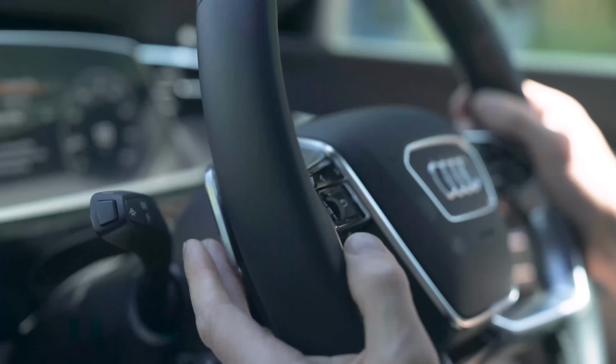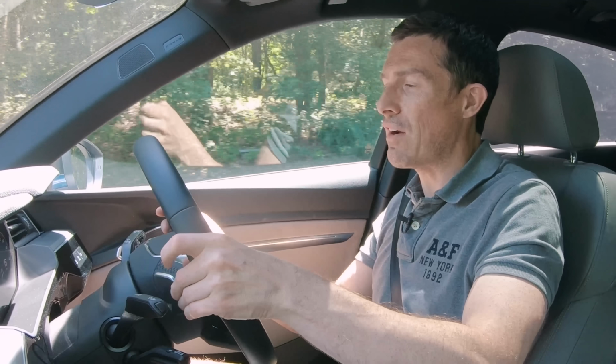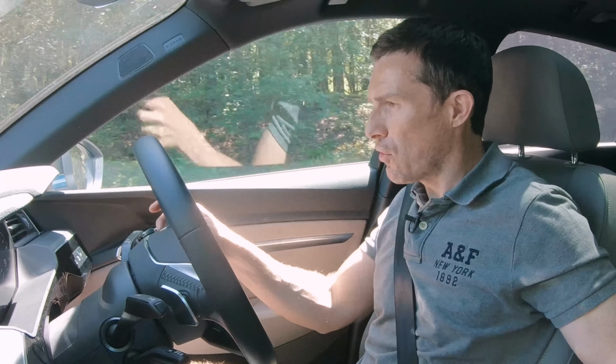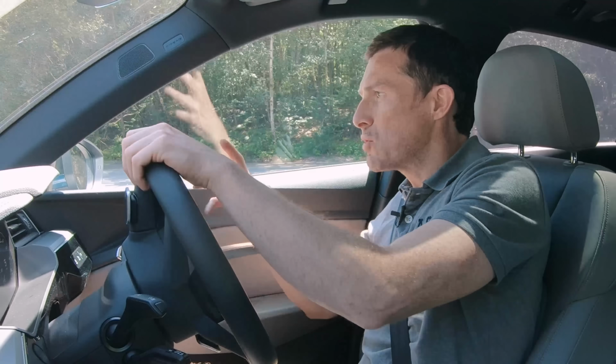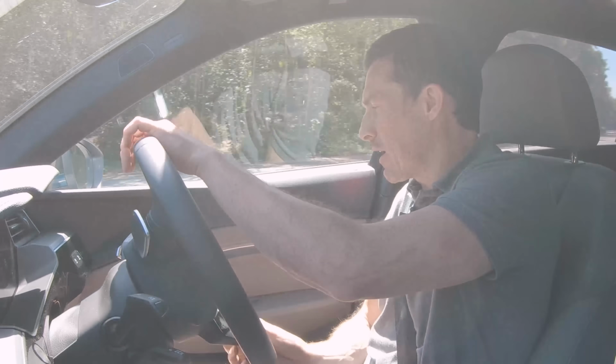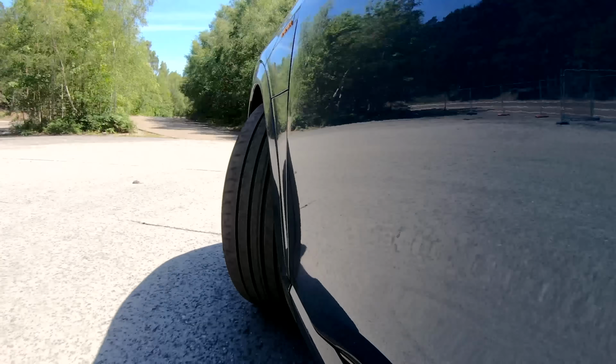Now, this car has gear shifter pedals, but they don't actually operate a gearbox. Instead, they can alter the severity of the regenerative braking, so you can basically drive the car on the throttle alone, lift off, and it slows like you're touching the brakes. If you do need to engage the actual brakes, the transition between that regenerative braking and normal braking is quite natural.